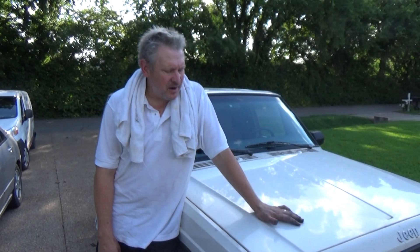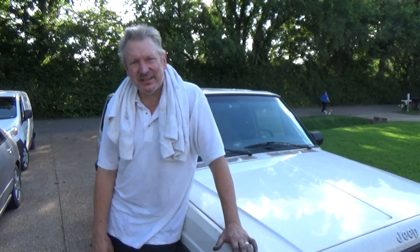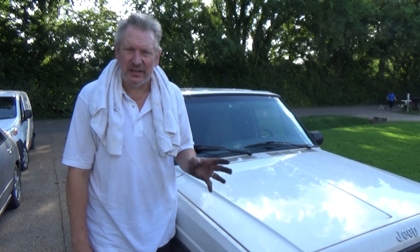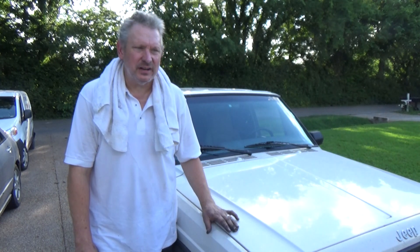It's got almost 200,000 miles on it, but that seemed to help with the misfires, especially starting it up — it was almost flooding out a little bit when it started. We're going to throw some Seafoam in it. It's running a lot better. There isn't a car that's much easier to put plugs, wires, caps, and rotors in. When you're changing your wires out and your cap, just transfer one at a time and you don't really have to think about firing orders. She's running. We've got millennials driving this thing, so it's kind of hard to get a good report on whether it's missing at idle, because they have no clue. If it starts, they drive it. If it doesn't start, they go there's something wrong with the truck — and that's about the amount of information I get.